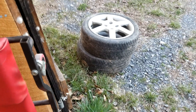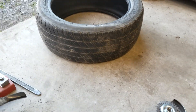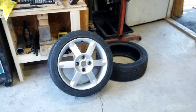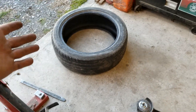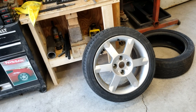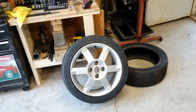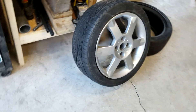Next up is changing tires. These two have decent tread left so they go on the back, but the fronts are pretty shot and won't be as grippy for track time. Unfortunately I only have these two — they were free, they came with the Nismo wheels when I bought them. So I'm taking these 2019 Uniroyal Tiger Paw all-season tires and swapping on these older higher-performance tires made back in 2010 according to the date — 13 years old versus 4 years old all-season. They might honestly be the same, but hey, the tread pattern looks cooler, so that's something.